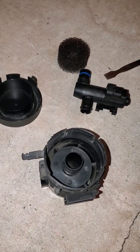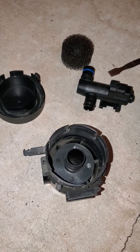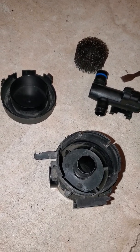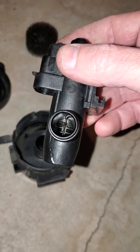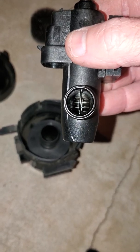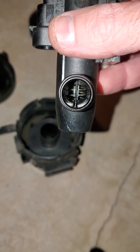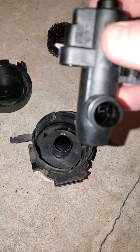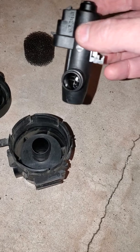I took it all apart — it was disgusting. The issue I was having was a P0442 error code, and I've been getting this for a couple years, but I only get it in the winter and it goes away in the summer. Maybe something's contracting in the cold. What I'm thinking is the actuator in here is maybe contracting when it gets cold and isn't able to close shut when it gets triggered electrically. I think maybe it's not closing all the way.